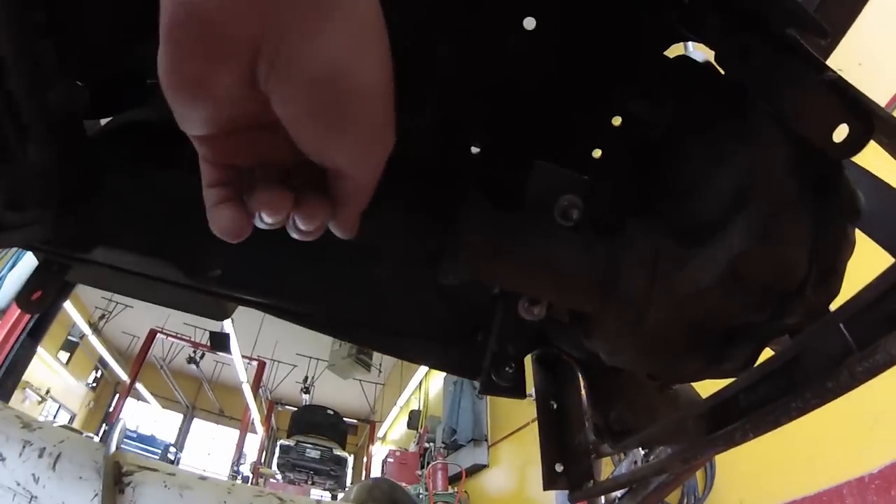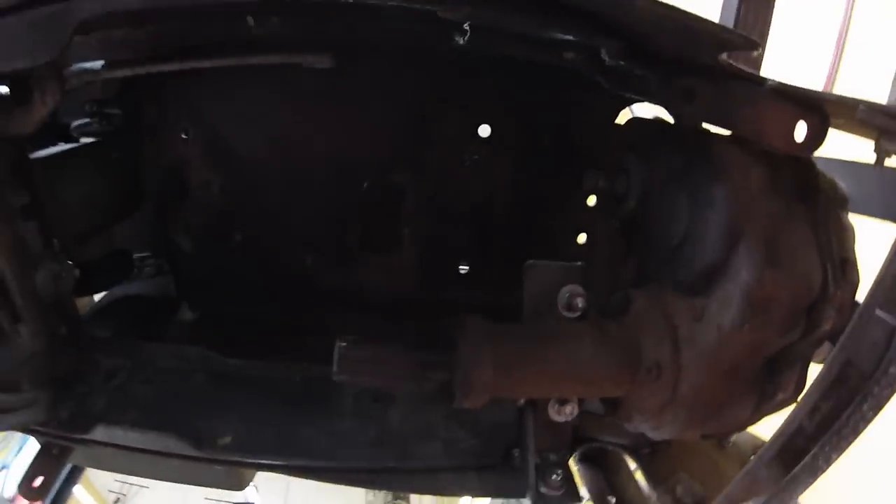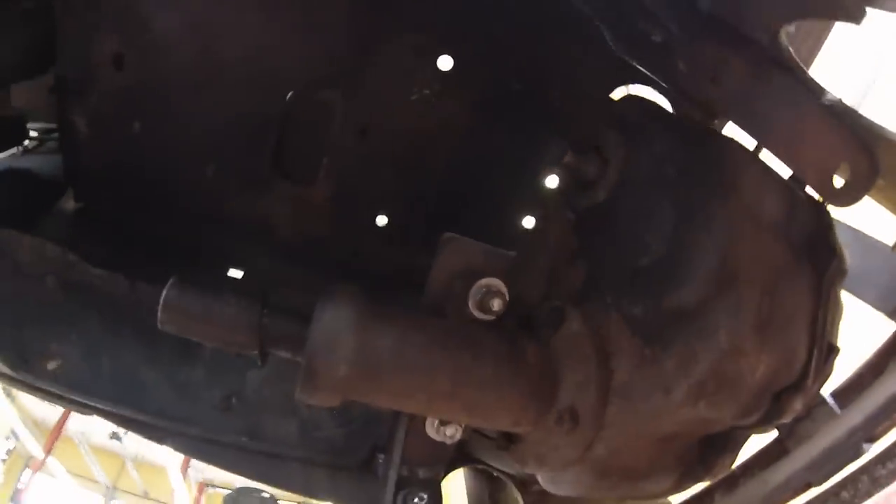So this is a look underneath. This will be the axle for the left side — there'll be a chain coming this way. And this is going to be my new input here, a 3/4 inch shaft, so I'll have to put a U-joint on there. Then I'm going to either couple it up to that power takeoff up there, which will be belt driven, or somehow redo the clutch system so it has a direct shaft back to there to drive. I've still got a mount up in here — I'm going to mount it a little better than that, but it gives you an idea of what it's going to look like with the transmission turned.